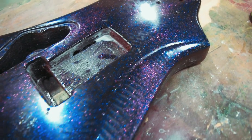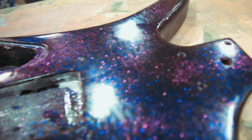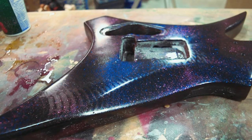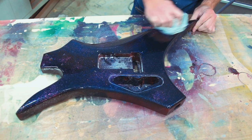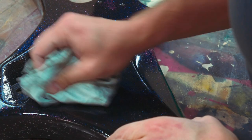You don't have to use a DA sander — you can do it by hand. This is my preferred method; I find it a little faster and it gives me a nice thin layer. I haven't used this specific product before, but I have used something similar, and this is how I like to do it. So that's what it looks like with the sealer on there — it hasn't been buffed off yet. I'm going to leave that half an hour, and then we'll remove it just using a soft cloth, just a chunk of old t-shirt. You can use a microfiber cloth — just be careful, because on a black finish they can leave swirl marks as well.